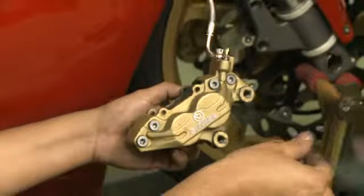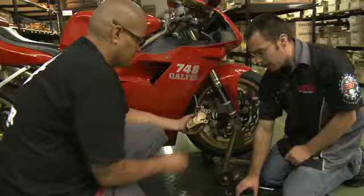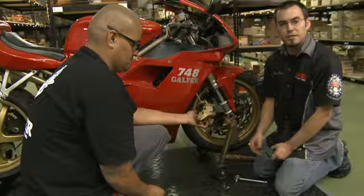Okay, so we've got our new set of brake pads. What we've done is we've cleaned the inside from any brake dust — you want to always clean the inside of your caliper. We also recommend using maybe some Scotch-Brite to resurface the pins and the clips.